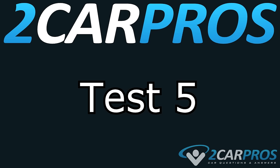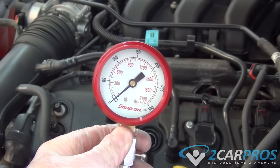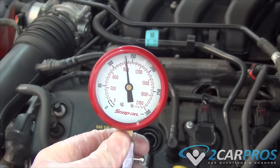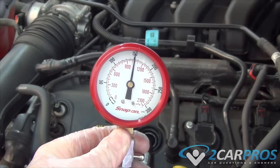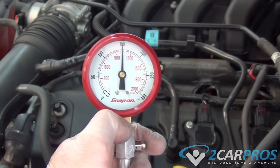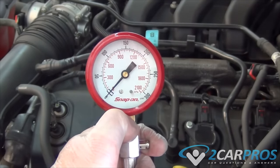While testing the radiator air, the test fluid will turn yellow if exhaust gases are present, or remain blue indicating the opposite. This is test number five. A head gasket can fail between cylinders, causing a consistent two-cylinder misfire. To check for this condition, remove each cylinder's spark plugs while conducting a compression test. If two readings are consistently low in neighboring cylinders, this can be an indication of a failure between those cylinders. I'll put a link in the description below to a more detailed test for this.